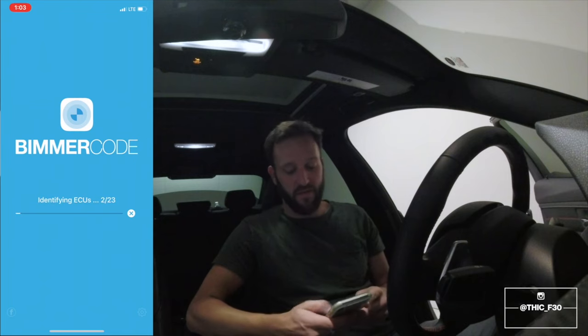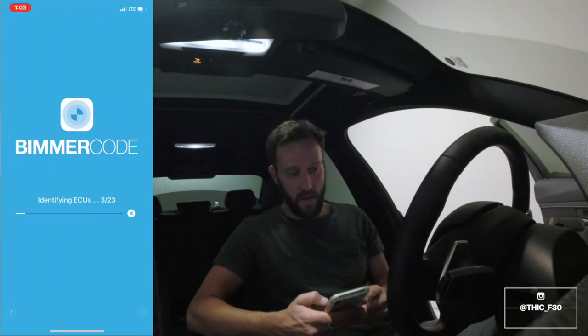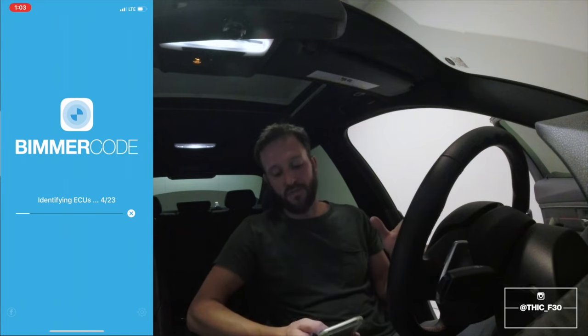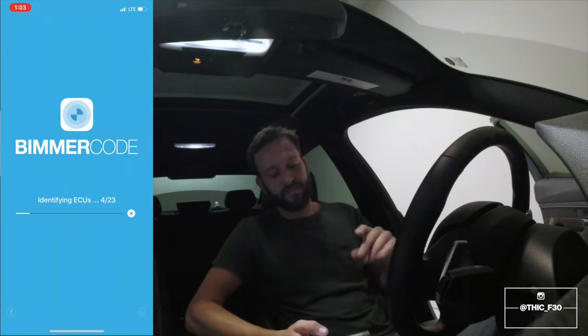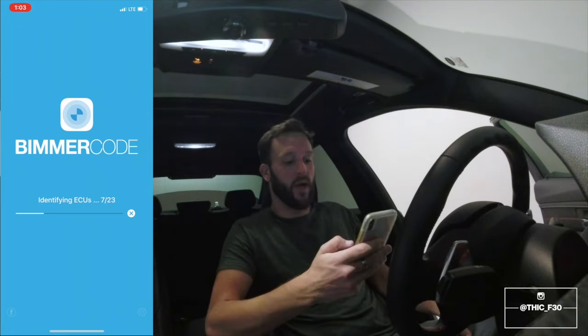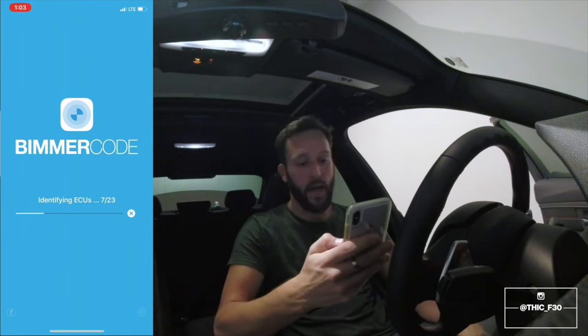All right, so we are in the final stretch here. Everything is installed. I did turn the car on and try it out. Paddle shifting was not working. So we have to assume that the car is just not coded for paddle shifting. We're gonna go ahead and open up our Bimmercode app.